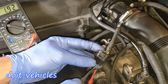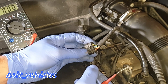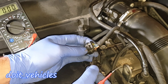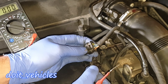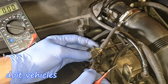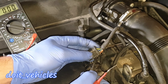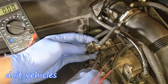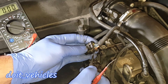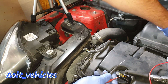How can you distinguish between the signal wire and the ground? First of all, you can see the thickness of the wires — the white and the green ones are thicker compared to the yellow and the blue ones. They are obviously thicker, so that's one sign that you've got the 12 volt supply and the main ground. Usually the signal wires are more colorful — I've seen red, yellow, pink, or double colors. The 12 volt supply and the ground always have just one color, and that's how you can easily distinguish them.